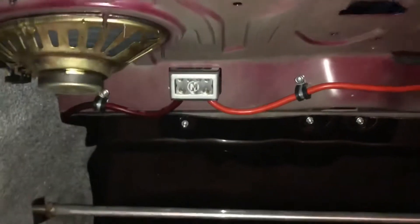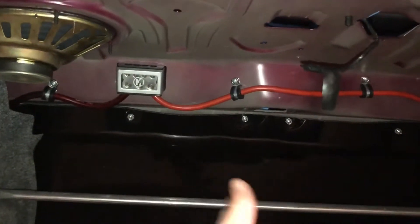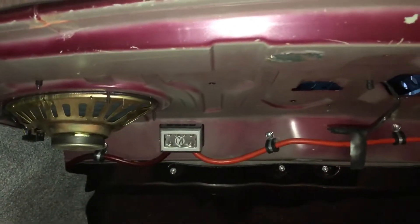On to today's video: something I should have done when I relocated my battery and just never thought of — adding a fuse holder. I've got a distribution block so I can have a fuse for the two-gauge wire that runs from the battery to the front where the ECUs are. I'm going to remove the old distribution block I used for stereo stuff, pull the negative off the battery, mount the fuse up there, and I'm going to run a 100 amp fuse — the kit came with a 150 for two-gauge wire.